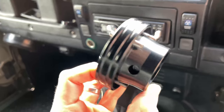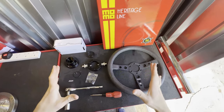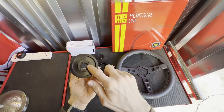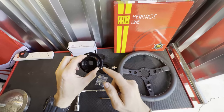Now let's talk about what we're going to need to do the job today — what equipment we're going to need and what the parts are when they're all broken down. I've got all the bits lined up here. I have gone for a 48 spline boss — that's the little grooves on the inside of here. There is another one available, so you've got to check what your car has and what the steering column has to get the right one.